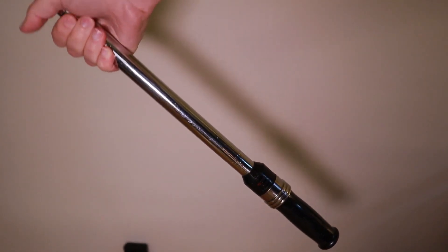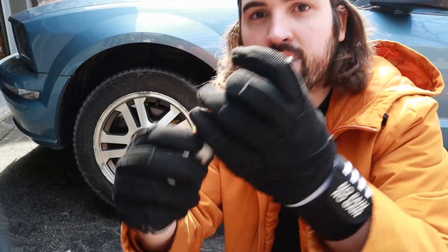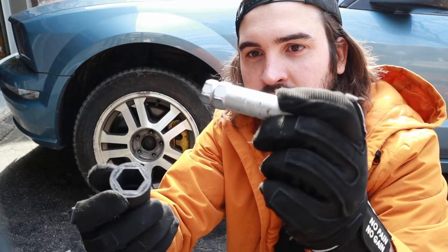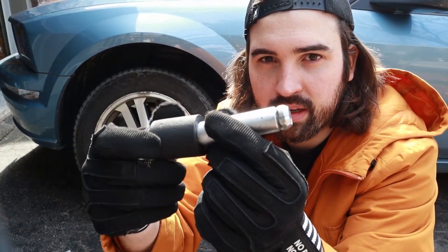For this experiment, I'm going to be using a torque wrench to set the torque. I'll start low and work up in increments of 20 foot-pounds until we hit 100, which is the recommended spec for this car. I've run into an issue where the socket isn't clearing the rim, so I'm going to switch to a wheel that uses these nuts and a special lock socket to take them off, which will fit here and should work fine.